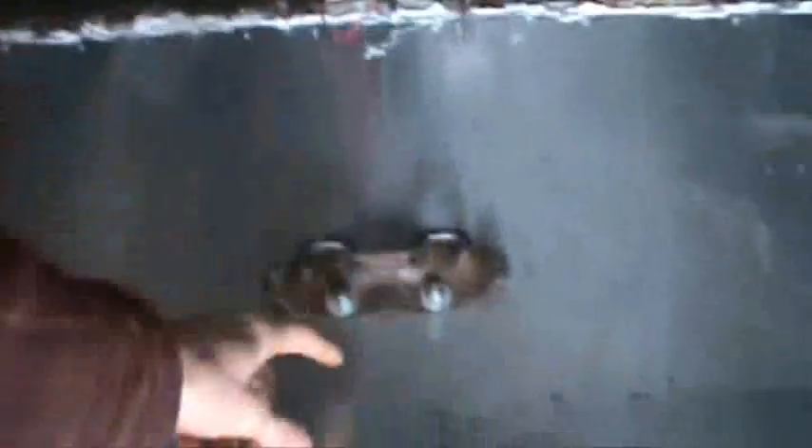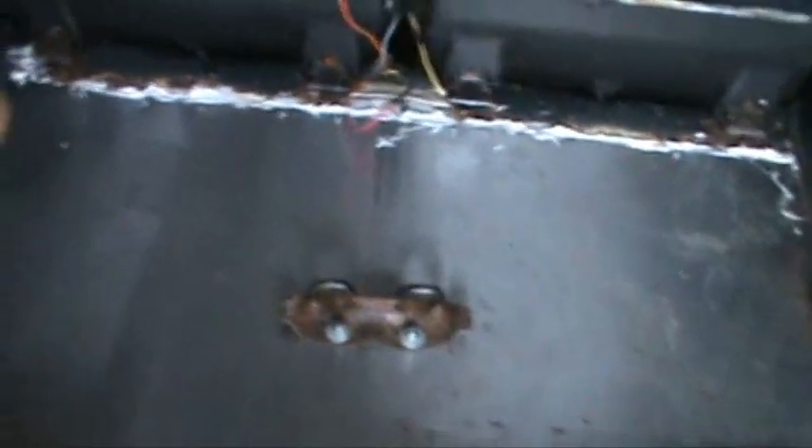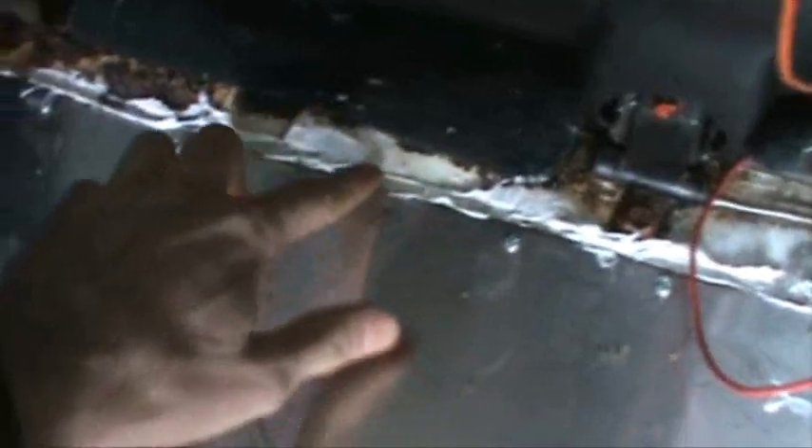This was a huge mess. This entire section was so rusty — I ripped most of it out by hand and then cut some out. Under the stainless steel, that whole area was missing. For instance, this remained attached to the seats when I moved the seats up, which is not a good thing. But now it's totally good. I cut this to fit — it even goes up the side — and screwed it in with self-drilling screws and caulked around so that road wetness won't squirt inside. I did keep the same ratty old carpet just to give a bit of insulation.